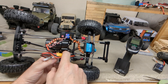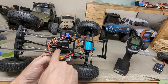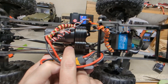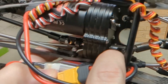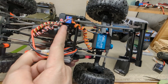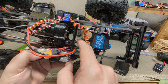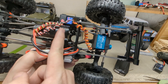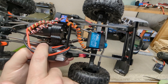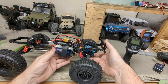This front driveshaft is super short. I actually had to flip the gear on the output shafts — you can see this one here is a little bit longer. The actual shaft is longer than the other one. I had to flip it around so the longer one stuck out the back and move the transmission back a little bit. It was like 50 millimeters and just way too short, so moving the transmission back and flipping the output shaft gave me the little bit of give that I needed.